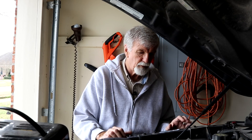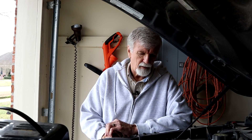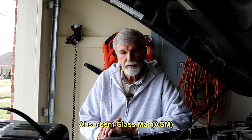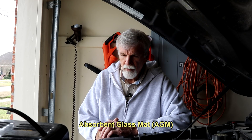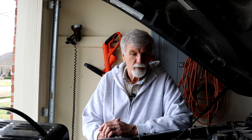AGM is a different story. I've never had one, but it'll probably be my next battery. They're a little more expensive but may be worth it. An AGM is a lead acid battery — some people confuse it with gel cell but it's not. It's not a flooded lead acid battery. It's absorbed glass mat material — AGM. That's a pretty good design, but it can be abused easier than a regular flooded lead acid battery. An AGM is designed to run at a float charge of about 13.2 to 13.6 volts.